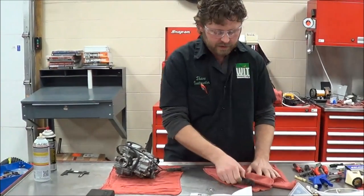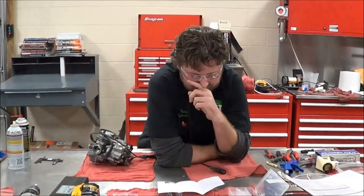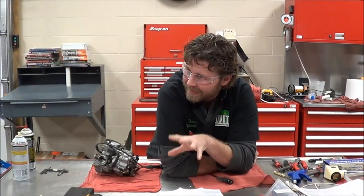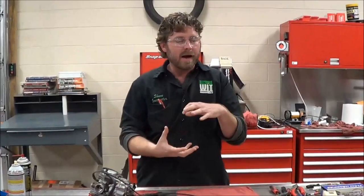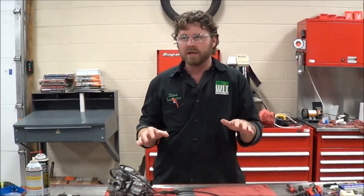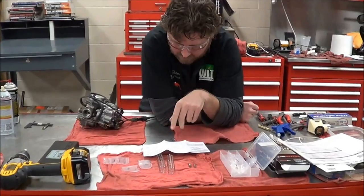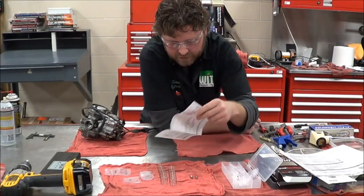The next step is figuring out between our service order and our customer what exactly he intends to do. This jet kit comes in stages — stage one is typically for a bike that uses a stock air box, not necessarily stock air filter, just the bracketry and box the filters are housed in. When you go to individual filters, that is stage three. This one says stage one, the right year and model, and it says it can be used with stock air filters or an aftermarket exhaust system.